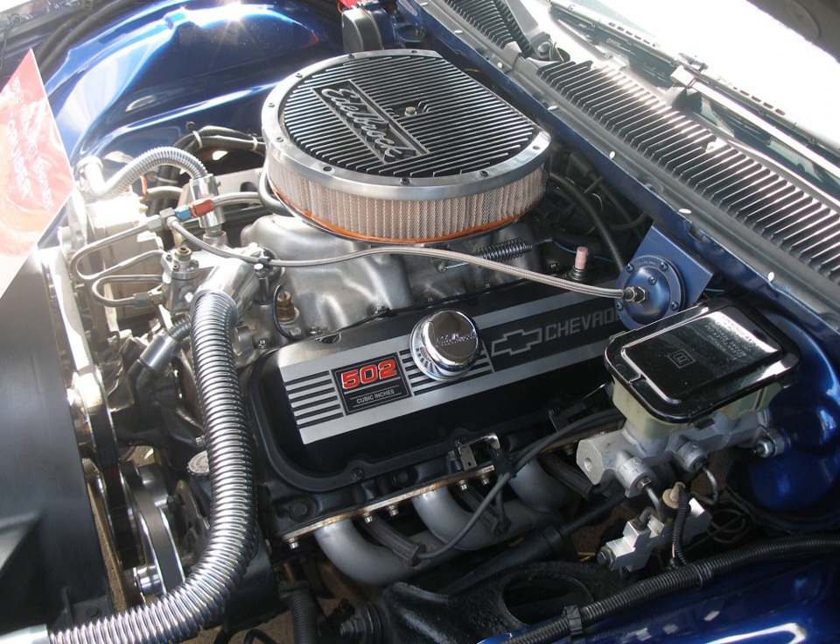The aluminum body parts were fabricated in Flint, Michigan at the facility now known as GM Flint Metal Center. Unlike the later second-generation 427, it was based on the W Series 409 engine, but with a longer 3.65 in stroke. A high-rise, two-piece aluminum intake manifold and dual Carter AFB carburetors fed a 13.5:1 compression ratio to produce an under-rated 430 hp and 575 lb-ft. 50 RPO Z11 cars were produced at the Flint GM plant. Extant GM documents show 50 Z11 engines were built at the GM Tonawanda engine plant for auto production, and 20 partial engines were made for replacement over-the-counter use. Unfortunately, there is no evidence from GM that shows 57 cars were built.